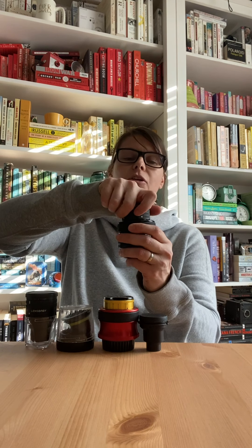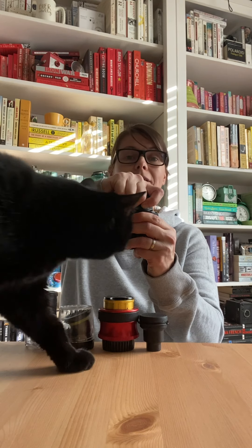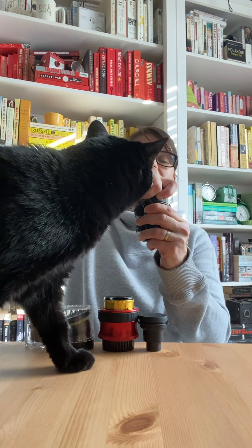The basic way of taking out an optic: you need to turn your focus ring so the optic is sticking all the way out the top — you want it all the way out, not in. Then take your aperture and turn it all the way to f22, which will make it a little easier when you go to turn it. Holding the Composer Pro in one hand with the focus ring tight, take your other hand, push down gently on the optic, twist it counterclockwise, and pull it out.